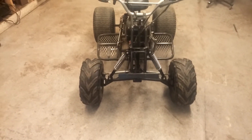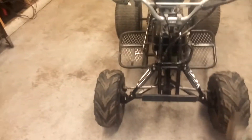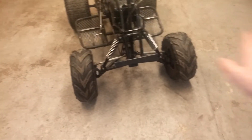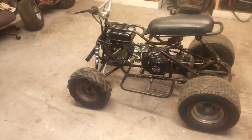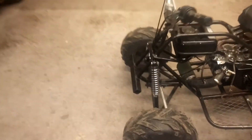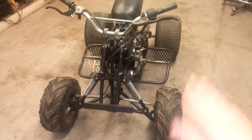There's a slight bump steer issue — you can see there's a slight toe out. When riding it's a little less toed out, pretty much straight. I have that toe out to compensate, so when you hit a bump hard this guy is going to straighten out, which is better than the wheels wanting to toe in. I ride standing up if I'm riding hard, and I ride the back wheels. Eventually I'll fix that issue and the suspension will soak up bumps without being a big deal.